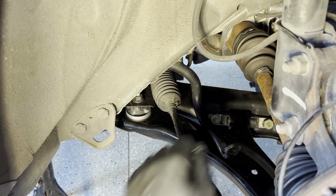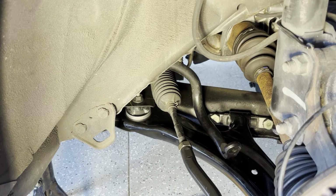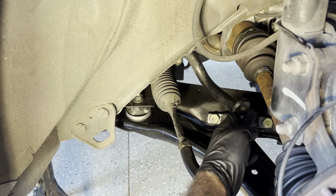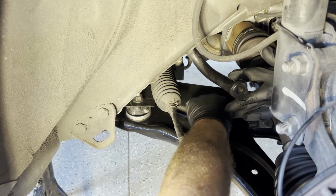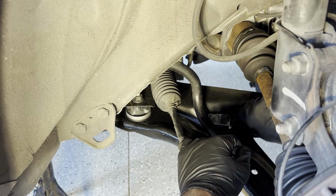All right, got you guys repositioned so you can better see these bolts going in. Again, if you get the wheel hub in the right position and it's lined up, these bolts thread straight on. But if you don't, then you would risk stripping the bolts. So you've got to be pretty careful to make sure that you're going in straight on. You definitely don't want to use any power tools, at least at the beginning, until you know you're threaded pretty good.